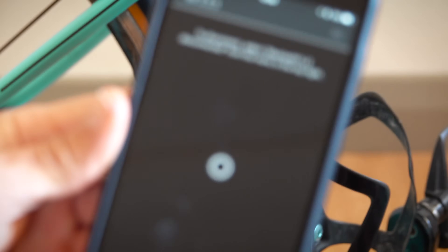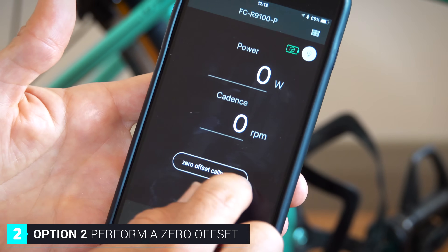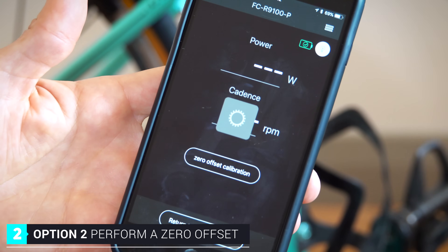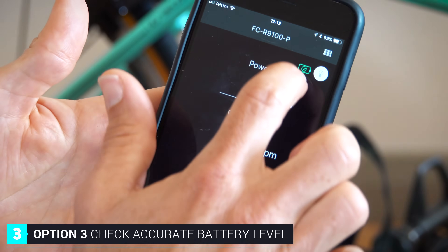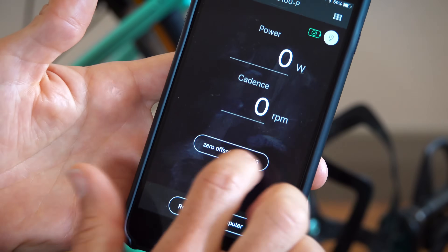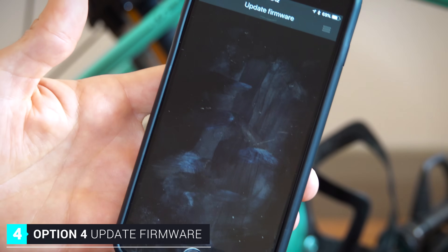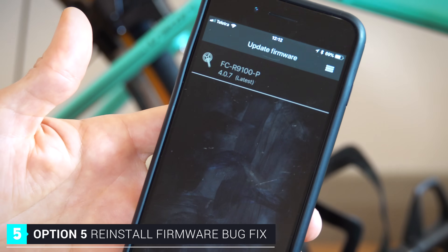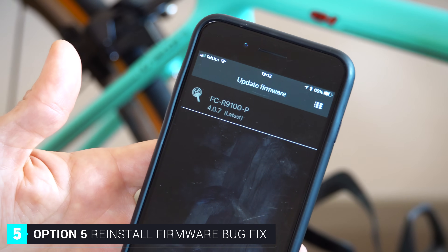Back in the app, press connect and you'll be asked to choose from a list of devices — select the Shimano power meter 9100. Once connected, you'll see a bike screen. From here you can use the zero offset function in the app — just make sure the crank is down at the six o'clock position and it will perform the offset for you. You can also see the battery level of the power meter. If you go to the top-right arrow button you can check and update the firmware, which is useful if an update is available or if you're having problems with the unit — reinstalling the firmware will often clear any bugs.